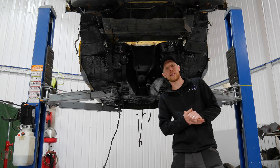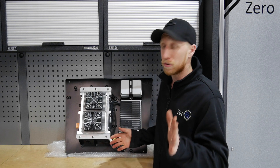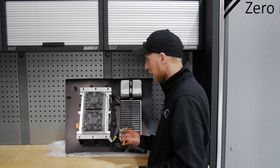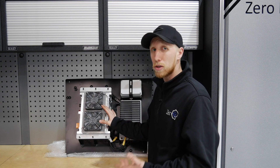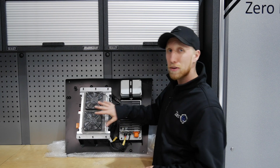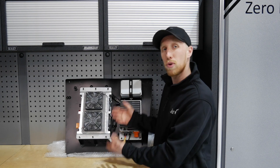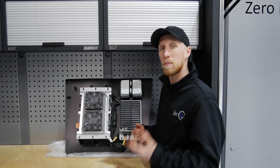With the under-sealing on the MX-5 now complete and all the welding work done, we're going to do a tech talk on the charger and DC-DC plate. Welcome to our tech time on this episode — we're going to be discussing the MX-5 charger DC-DC plate. We've fitted a 6.6 kilowatt charger, which will put 6.6 kilowatt hours into our 26 kilowatt hour battery every hour, given the right power supply. They also come in a 3.3 kilowatt version taking 16 amps single phase, while the 6.6 kilowatt takes 32 amps single phase. We also do an 11 kilowatt three-phase and a 22 kilowatt three-phase charger, but those are the Tesla ones.